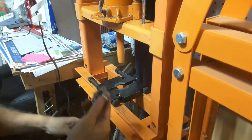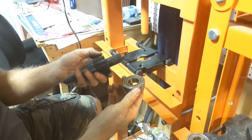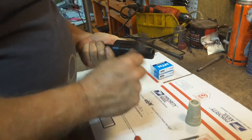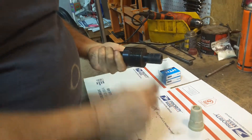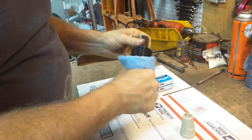There's enough friction on these bearings and this shaft that it takes a 12-ton press. You couldn't take them off with pliers or screwdrivers or anything like that. Now we'll just do a little bit of cleanup to get rid of the debris that was near the bearing area.